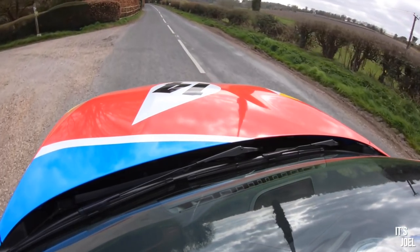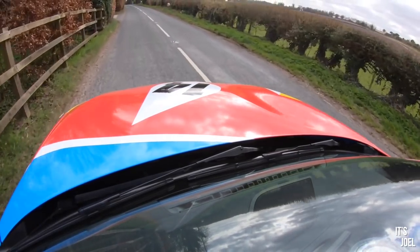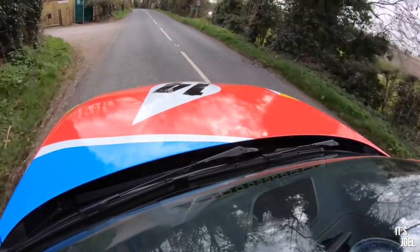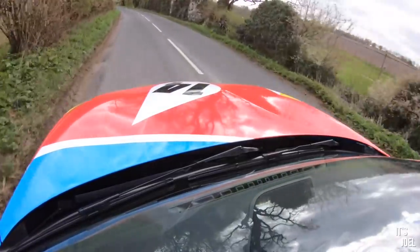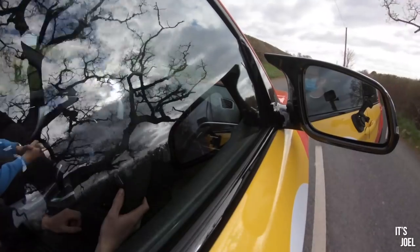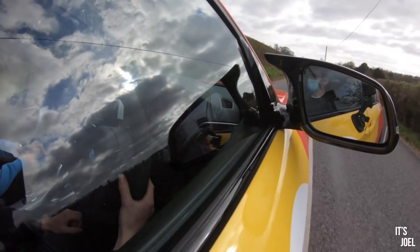It's the best thing I've ever done to this car, hands down. As well as being able to slide, what else do you notice? Just easier to drive really — pulling out of junctions it would just unnecessarily spin one wheel. It's just more grip. The car feels so much more predictable when you're on the edge, and it's not going to snap on you like it would with an open diff.